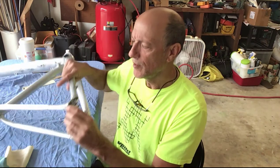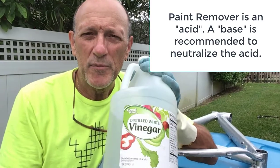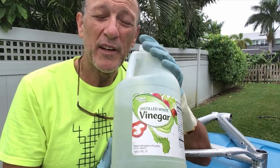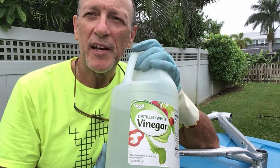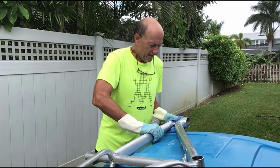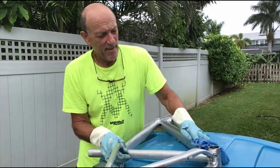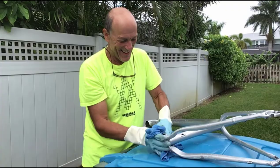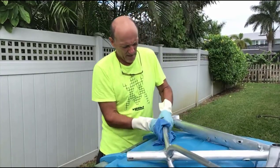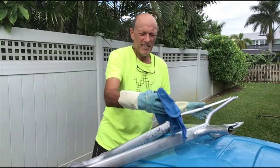Following the aircraft paint removal, I went into wet sanding with 600 grit paper. I'm at the stage where I've got just a little bit of paint left in the nooks and crannies of the frame. Now I'm going to mix up a solution of 50-50 vinegar and water and wipe down the frame — that will get rid of any residual acid from the aircraft paint remover. What's great is when you're done, you can use the leftover stuff to make salad dressing.